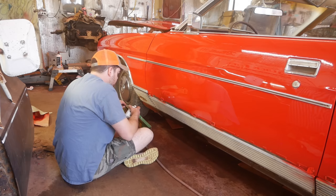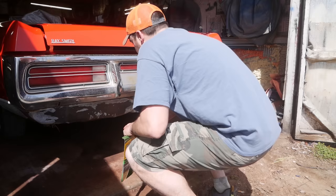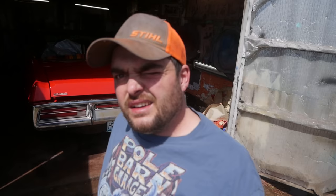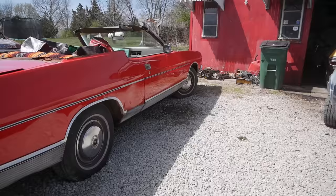Good morning — it's still here. The paint doesn't appear to have dripped any, it's still nice and shiny. But it's not dry — it's still tacky. That's the problem with not having the hardener. We can start to unmask it, though. There's a lot of dirt in it — prep work was a little lacking. Is there anything more satisfying than unmasking a car? That looks better with the bright work exposed. One thing I didn't do was paint the rockers because I ran out of masking tape. That's the kind of high-dollar operation this is. I'm just going to paint them black under here — they're going to look just fine.